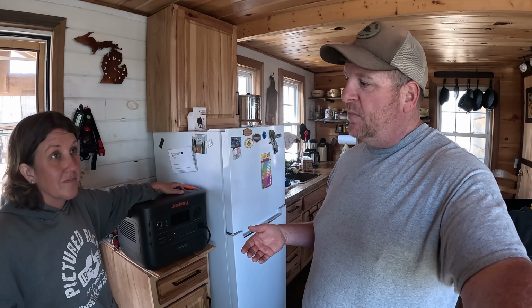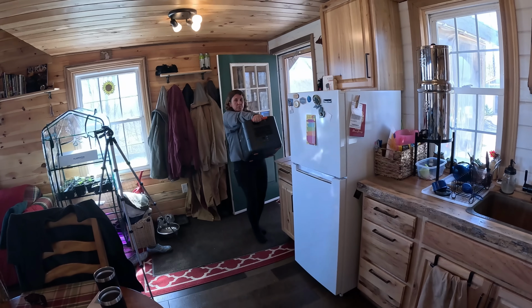Our refrigerators don't run continuously. They kick on for 2 or 3 minutes, 5 minutes at the most, turn off for 10, 15 minutes. So they kick on 2 to 4 times an hour. If this refrigerator runs for 20 minutes per hour, that's 54 hours. That's over 2 days at this rate.